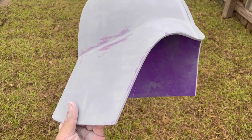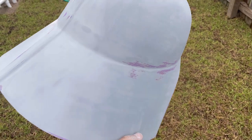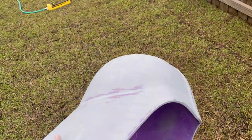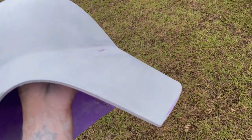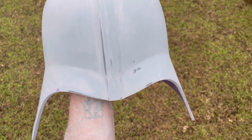All right, so here's the dome pretty much ready to go. This was two more rounds after doing two to three coats of filler primer. Sanded it with 320, did two to three more coats, and then hit it with 400. Again, I stress, you don't have to get super aggressive with this Bondo filler primer. You can even see how 400 grit is knocking down some of those high spots. And that's what we want. We want them all leveled and uniform.